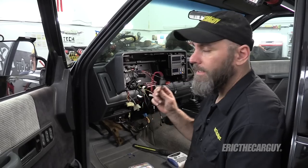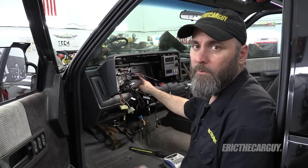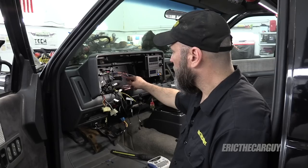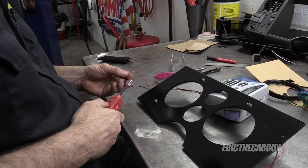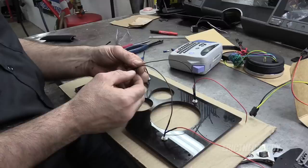The kit did come with an inline fuse but I did not use it, because I was taking my power from a fused source — so if I had put this in there, it would have just been redundant. This is all fused going up into here. All I did was basically eliminate what was going to the original cluster and I'm now making it go into my instruments. If you don't have a fuse and you're wiring things up from scratch, absolutely put it in there — otherwise, you can probably get away with just what I did.